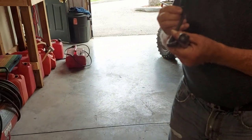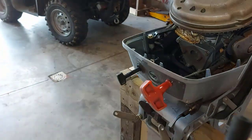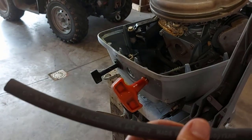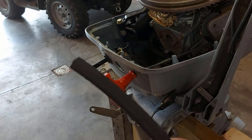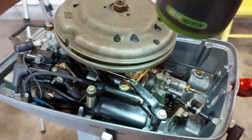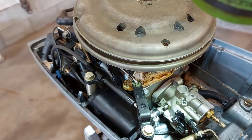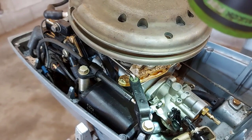So we got some new stuff. The old line was hardened right up — you can't even bend it. We got ourselves a new hose to put on there, that'll eliminate that issue. We put the new fuel line on from the fuel pump to the carb with new clamps. That old fuel line was gone, really brittle and hard.